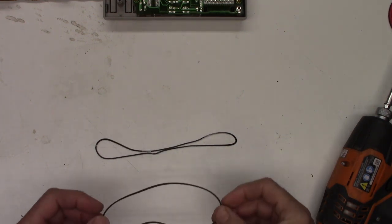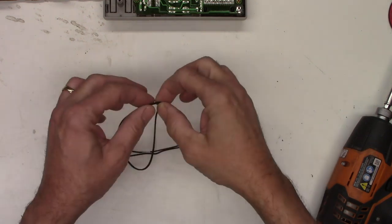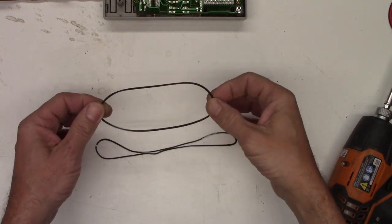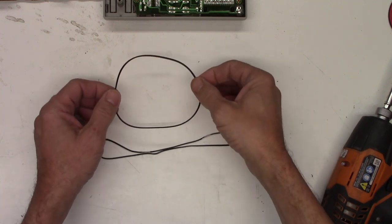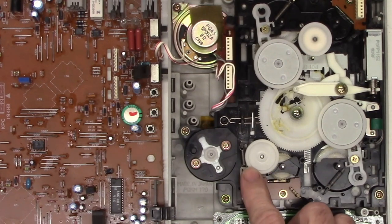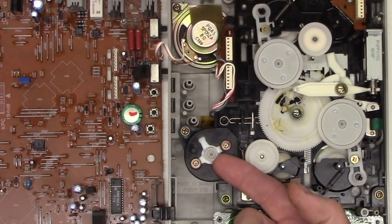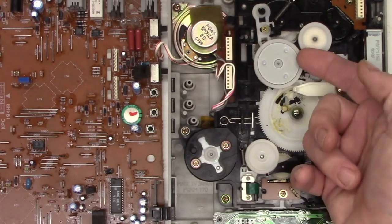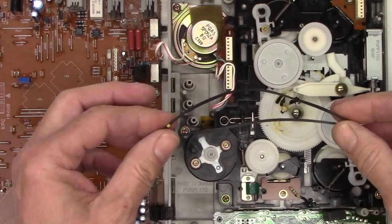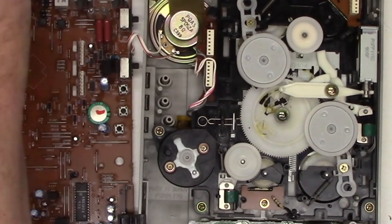I just happen to have a PRB — Projector Recorder Belt Company — SCX 11.8. It's in great condition; it's new old stock, never been used. So first thing we're going to do is get a q-tip with some acetone. I know you guys are saying you shouldn't use acetone, but I've been using acetone to clean belts, pulleys, and tape heads for close to 40 years with no adverse results. We'll clean and deglaze the belt first since it's probably 20 to 30 years old at this point.